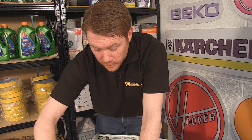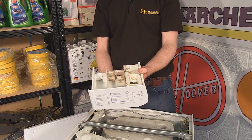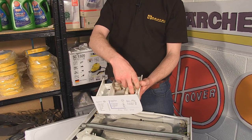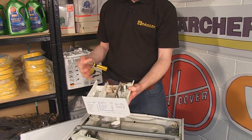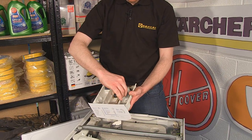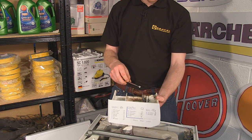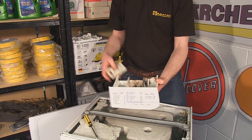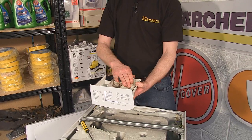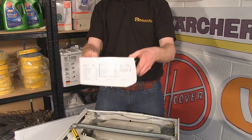One of the common problems with the soap drawer and the conditioner compartment is the conditioner not siphoning away. This can be due to old conditioner or gunk stuck in the siphon, like this one. It's very easy to clean — just give it a thorough wash in the sink. A good way to test it is to put it together and fill it up with water; it should then naturally drain from underneath.